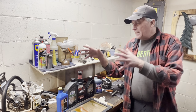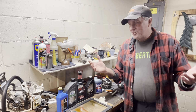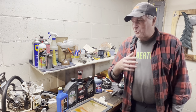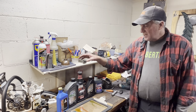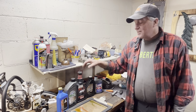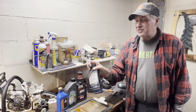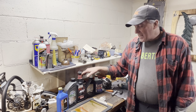But when I do these one tank tests, I'm more looking for lubricity and keeping everything moving. You'll have to keep an eye on your carbon wear yourself. I certainly don't have the time and means to run hundreds of hours and show long-term tests. But my main focus as a mechanic is I want your stuff to keep running and be well lubricated. So HB2 first place, H1R second place, Motul 800, and the 927. I know I'm probably going to get flamed in the bike community. It's just that one tank ran a little bit on the dirty side for me. Smelled great, and I don't think there'd be anything wrong with it, but I think they try and offset this. So this is 60% Castor base and 40% ester on the other side.